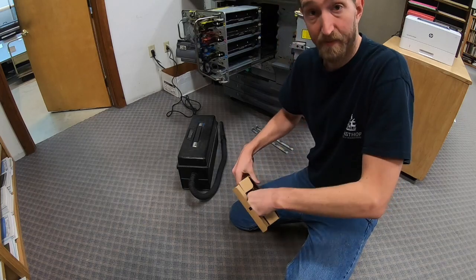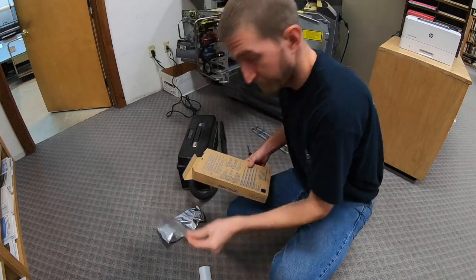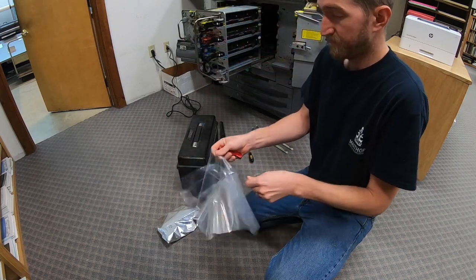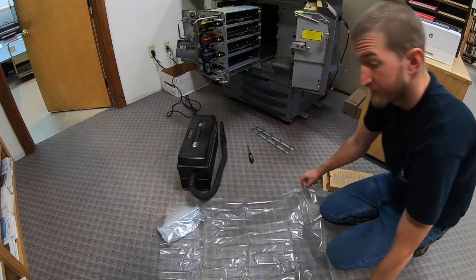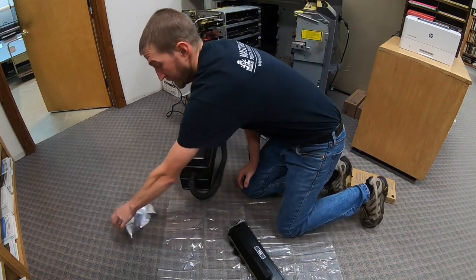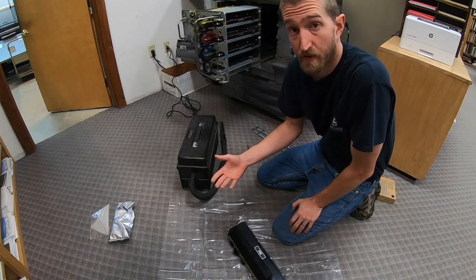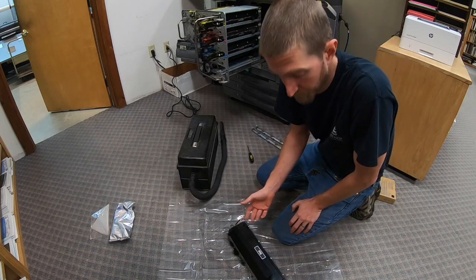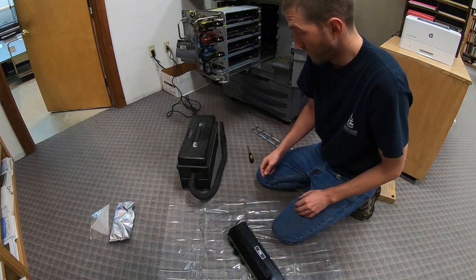In your developer pack you get three things: the developer, a funnel, and a large piece of plastic. Lay the plastic down for easy cleanup afterwards. If you've run this thing until it can't go anymore, it's going to be filthy — there will be excess toner because the worn developer was trying to compensate. So vacuum all that toner off first, then dump out the old developer.